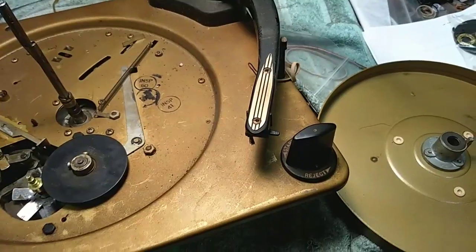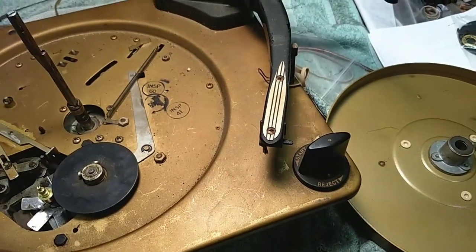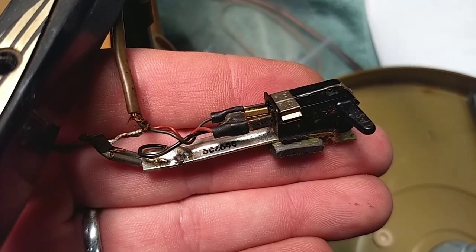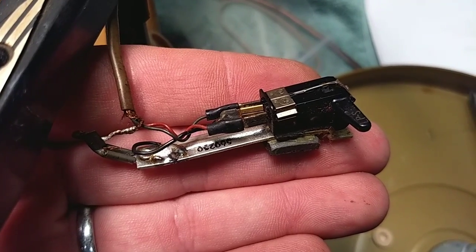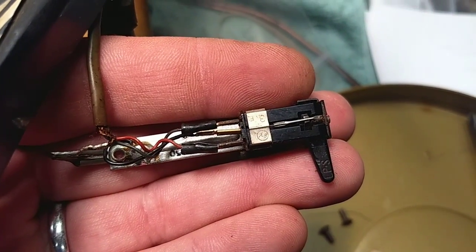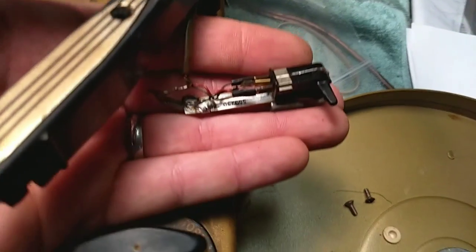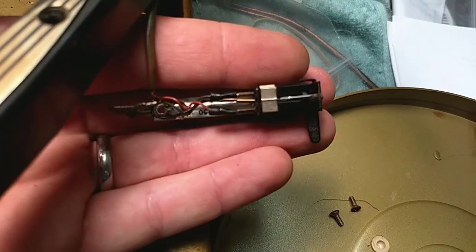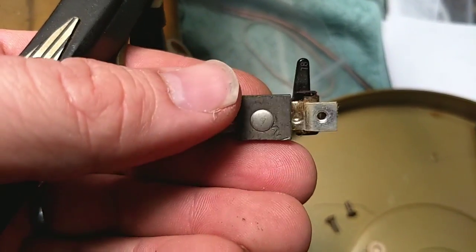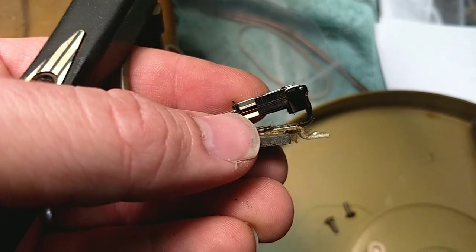What I'm going to do is take these two screws loose so that the whole bracket drops out of the arm and you can see what we're working with. Here's what you look at when you get this out of the arm. This is the Electrovoice cartridge — the original cartridge — and this has no output. Also the bridge has gotten very stiff, which is not uncommon at all. We need to find a way to outfit a new cartridge to this, and the difficulty is that everything is riveted together and we also have to maintain that angle.